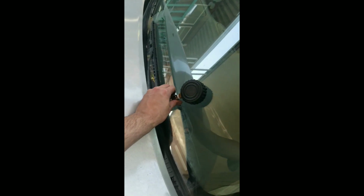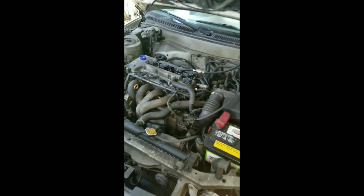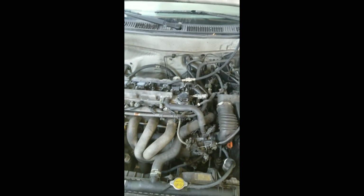Compression's only at 13 with the third cylinder. Even with oil, it's about 12.5. I'm going to call that 12.5. But I don't even think we used enough oil, to be honest. Squeeze that. Don't just go ripping it off unless you want a nice loud pop. But I don't think it's really going to hurt if you did it either way.